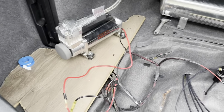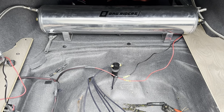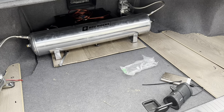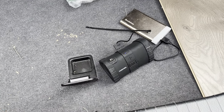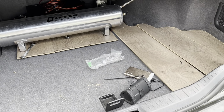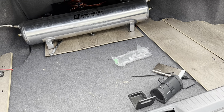Compressors are fully mounted. I'm going to put the false floor pieces back together, slip the carpet piece in, and do some wiring management to make sure everything's clean. Almost done — everything is wired and plumbed up. The last thing is to run the remaining line to the water trap from the spare tire rail. Once that's done, we'll unplug all the fuses, reconnect the battery, plug the fuses back in, and power it on.